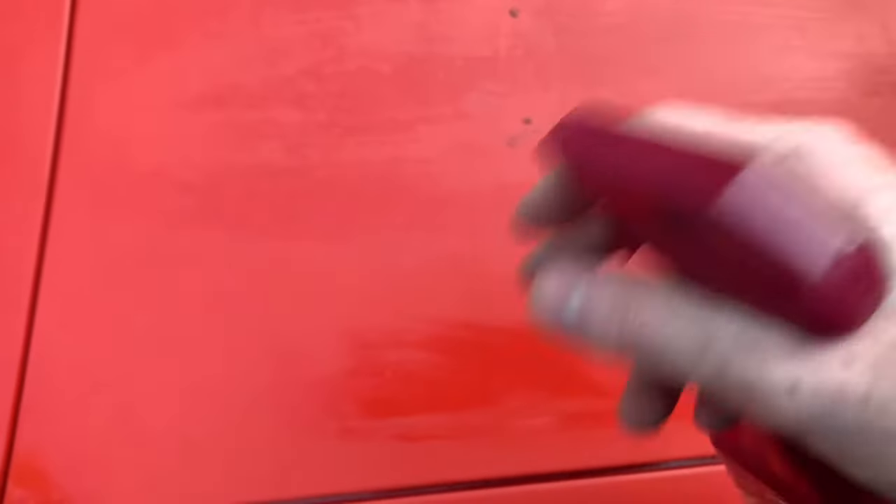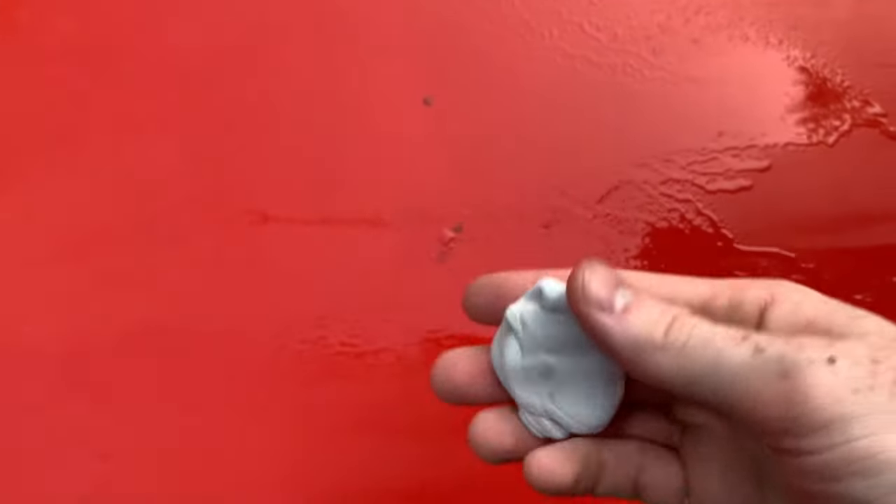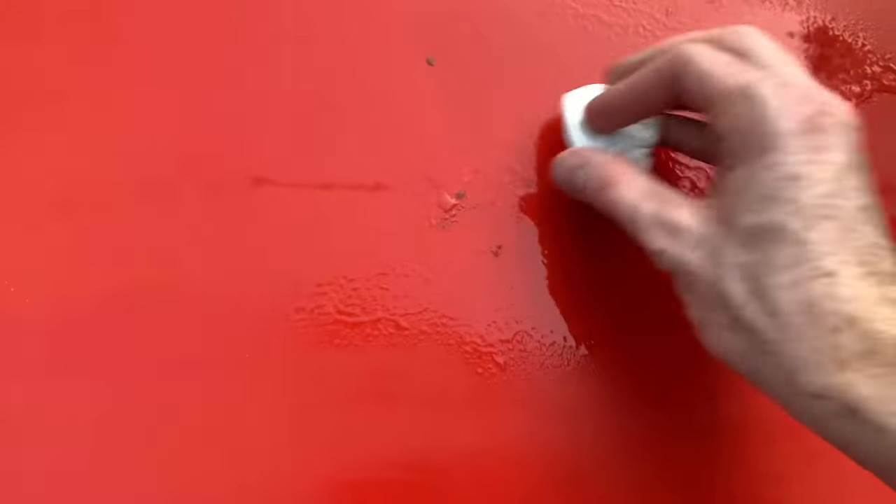This tar has been on here for at least a year and washing never gets rid of it. So I'm going to give it a couple of sprays with quick detailer, make a nice patty, and with nice gentle pressure go over it. You can see it getting stuck and my hand kind of slows down. As you work it in, it'll start to pick up those chemicals and all that gunk coming off.